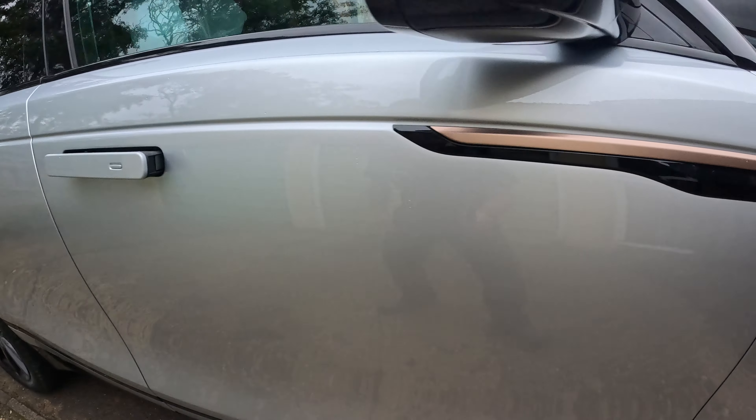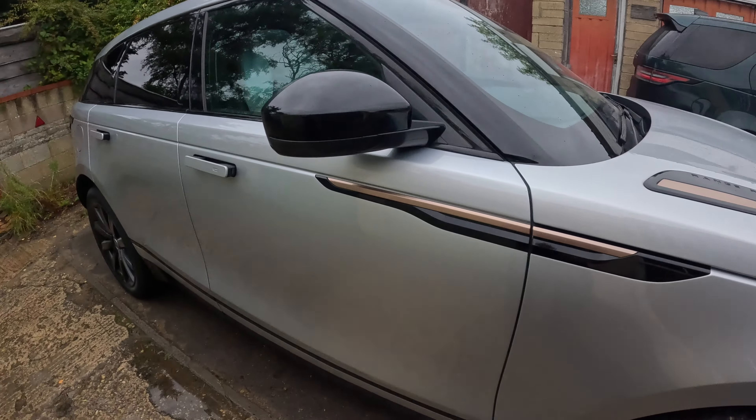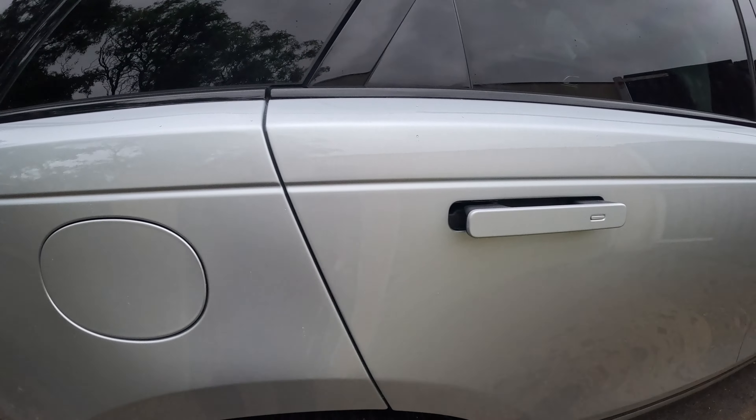There's a little bit of edge to edge here, but it's pretty decent — barely noticeable. Sometimes with silvers — especially high aluminium content colours — you're going to have some texture on the wet-on-wet surface. So if you do a panel with wet-on-wet next to one that hasn't had it, you can see a little bit of grain or texture in the base coat. If you look at it closely you can notice it, but it's not too bad. The Mepa 4+1 isn't the best designated wet-on-wet — it's a different mixing ratio on a high-build primer — but it dries really quickly and it is fairly smooth. Application can change it too.